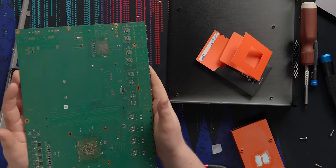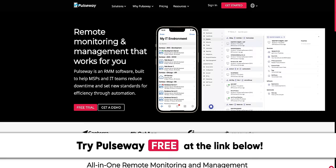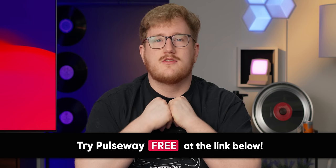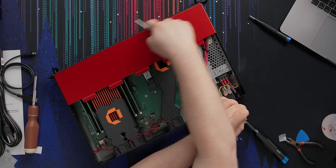Other than that we've got power distribution on the back, the NIC, SoC, RAM, storage, power supply hookups, and lots of ports. Let's put this thing back together, turn it on, and route some packets. I know how it gets airflow now — I wasn't really looking before, but these are exhaust fans, which means it's going to pull in air all along the front, around all those ports, and then it just gets sucked through in a few particular places.